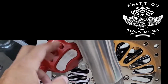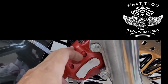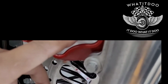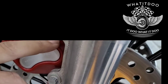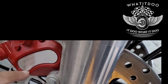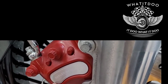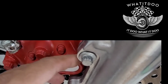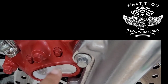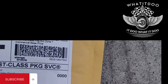All right, y'all. Just so y'all know, when you get these older models chromed out, they don't have the net right here, but if you see my other video, a chrome plating shop will chrome this for you too. The new ones have a cap right here. For these older ones, you see this here? The ones that are getting chromed, this won't be here anymore. So you get an option to either shave it down smooth or keep this peanut-looking notch in there. When they chrome your calipers, they can sand this whole groove down. If you see a little chip here, and you see that groove, they'll sand that groove down and chrome plate everything, so you don't need this part. Then you can put whatever you want, but I told them to keep this here.